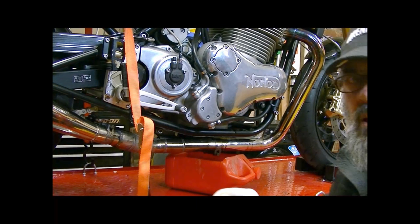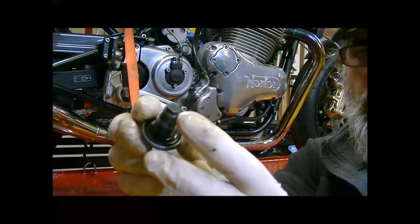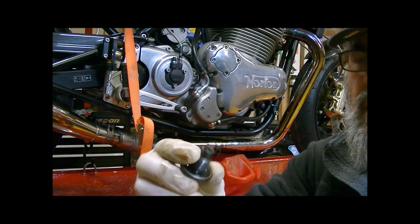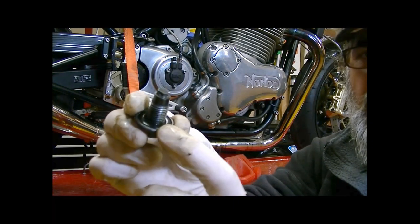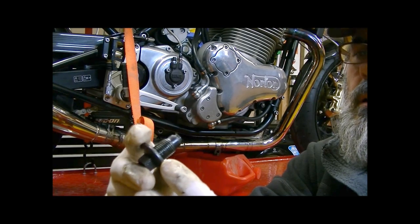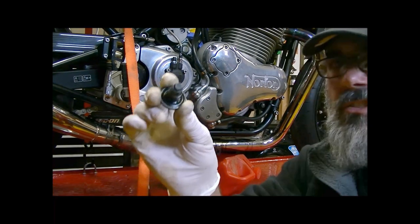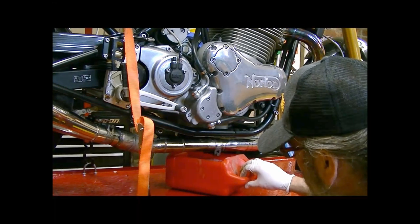Just give that a little bit of a clean up. It's got a little magnet on there so just check that - seems quite clean. Just wipe it with a little cloth; there's not much on that so I think we're okay there. There's a rubber o-ring around the inside of the plug which looks fine to me, so we don't need to change that. So that's the drain plug out - just leave that on one side now and let the oil drain out.